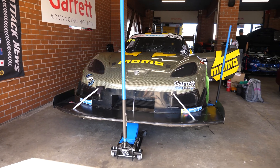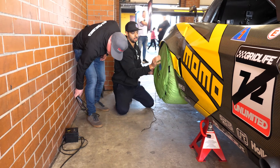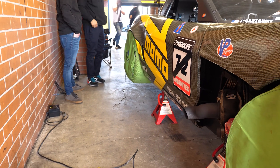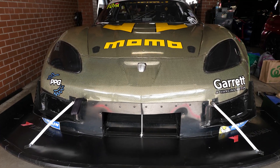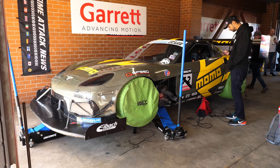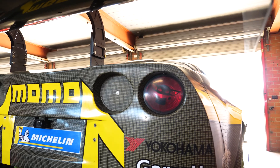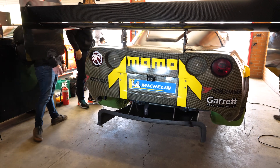Visually the car's a bit of a different color to what we saw it last. The body panels have changed. We got the HGK carbon Kevlar kit — it's their drift body, chosen for weight purposes. It was 80 pounds lighter than the full carbon body that I had. On top of that, it looks great. Made for drifting, carbon Kevlar is also pretty robust. We're not trying to take any hits, but in drifting they take some good hits.